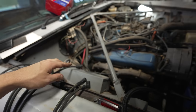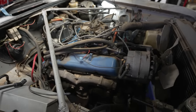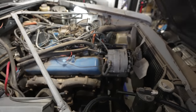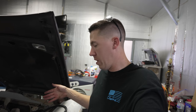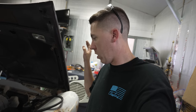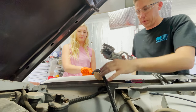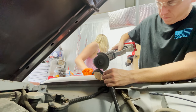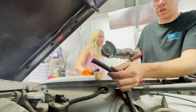I'll save these AN fittings in case we want to clean it up, or they're perfect once we start going to EFI up here if we do like a Sniper or one of those EFI conversion units. So I'm just gonna cut it with my little cutoff wheel, then go back there and spray some brake cleaner in the line and air it out, blow out all the crud. The cutoff wheel still cuts pretty decent.